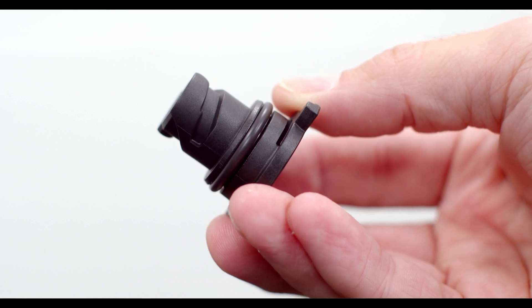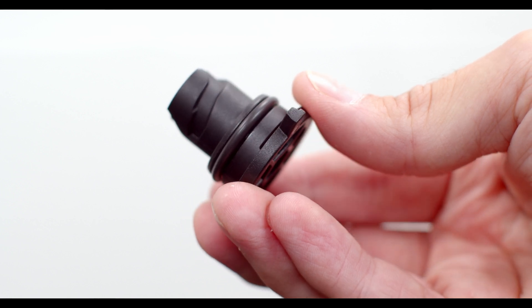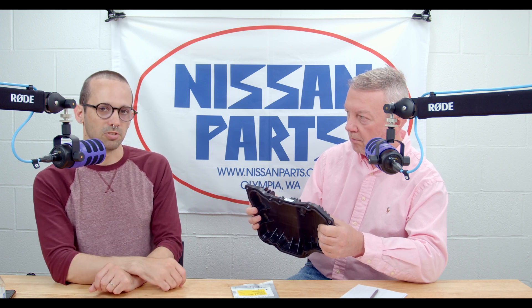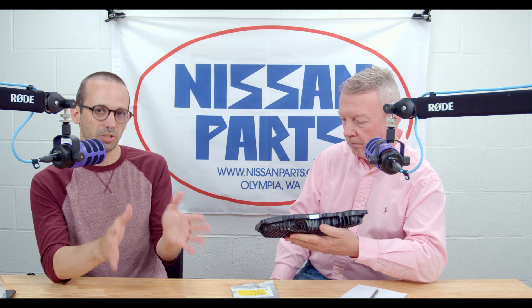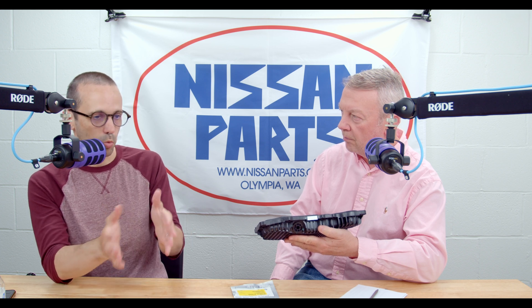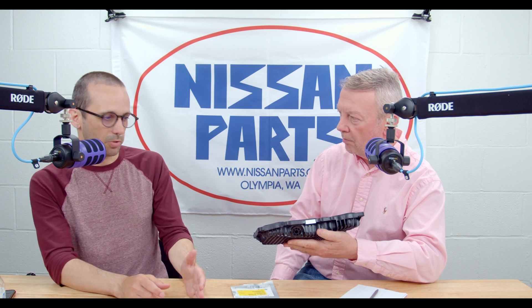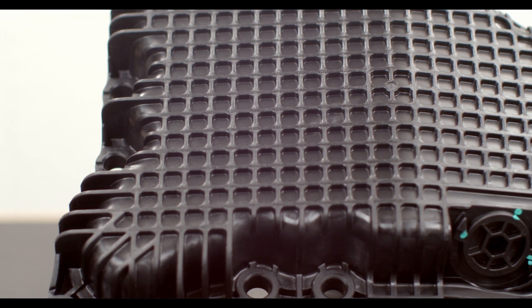This is what sort of sprung this video. I was doing a little bit of research on these pans and saw there was a new part number. I was looking at the drain plug — it was being listed as a single-use part by Nissan, which means if you take it off the car, you need to replace it. So we kind of backtracked it. If a Nissan parts employee goes into the parts catalog now and looks up one of the earlier — pre-'25 — models, the 2021 to 2024, it's going to come up with that original part number with the brass fitting, but it's not going to let you order it. You have to change to this pan upgrade.